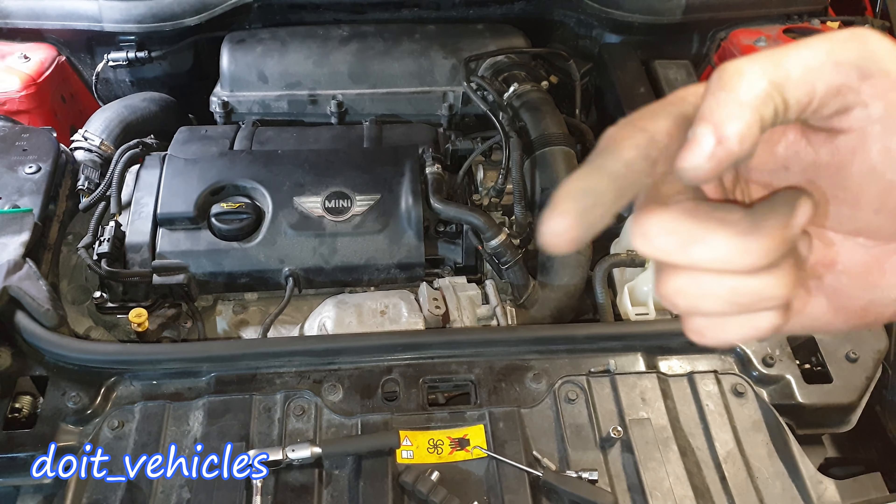With the intake manifold out, I can now present the components down here. This is the evaporative solenoid. This hose goes all the way to the blue line and connects to the evaporative canister. This is the turbocharger wastegate solenoid, which takes vacuum from the intake and releases it when the computer commands. We've also got access to the starter. Count how many connectors you have so you know how many to reconnect. This white connector goes on the wastegate solenoid.